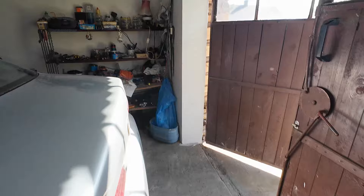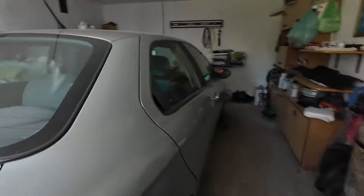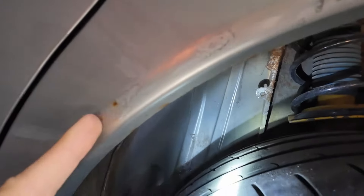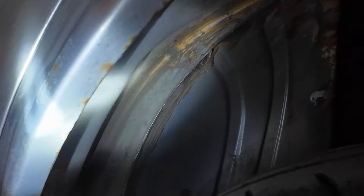Then we will proceed with taking off the bumper and painting the other side. I have to take off the bumper in order to paint the other side, because as you can see this is in a very difficult place to get into without removing it. But the good news is I will be able to do some work on that without removing the bumper — basically just some specks of rust. I'll clean the entire wheel arch, put on epoxy primer, and then paint it. I know it's not going to be perfect, but I just don't want to see all those rusty dots.